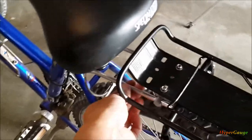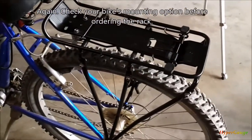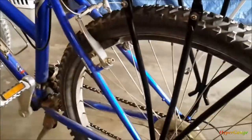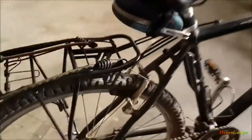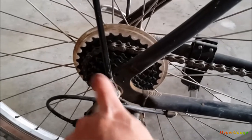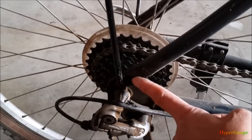Don't lock everything down while you're installing it. There are many different styles and materials for bike cargo racks. Before you buy one, check what kind of mounting system your bike frame offers. If you don't have the two mounting holes on the side, you'll have to find another solution. My old cargo rack, for example, didn't mount to the frame — it mounted to the seat pole, and the support pole goes straight down to the wheel axle. Make sure the one you buy will fit the frame you have.